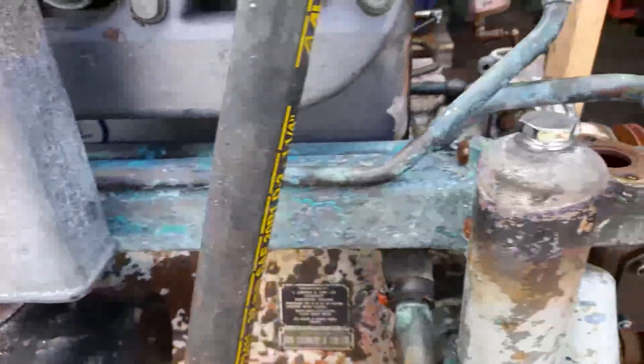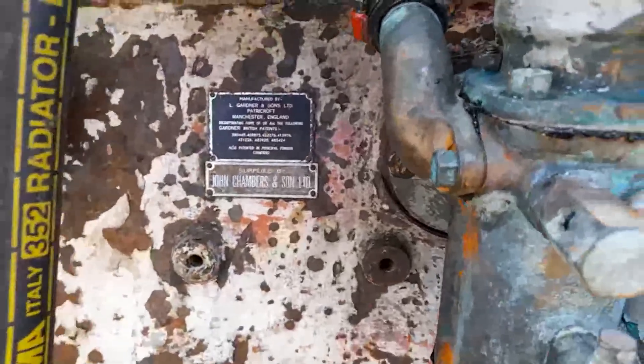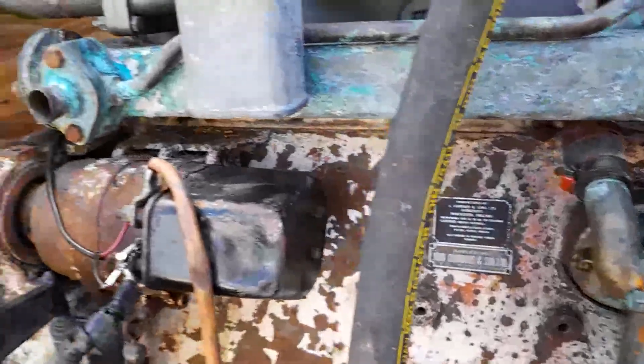This engine has got all the classical components of a proper marine engine: the oil cooler, reciprocating pump, extended crankshaft, cast iron crankcase. And as you can see, it's not in bad condition at all. If there was an alloy crankcase it would be much more corroded.